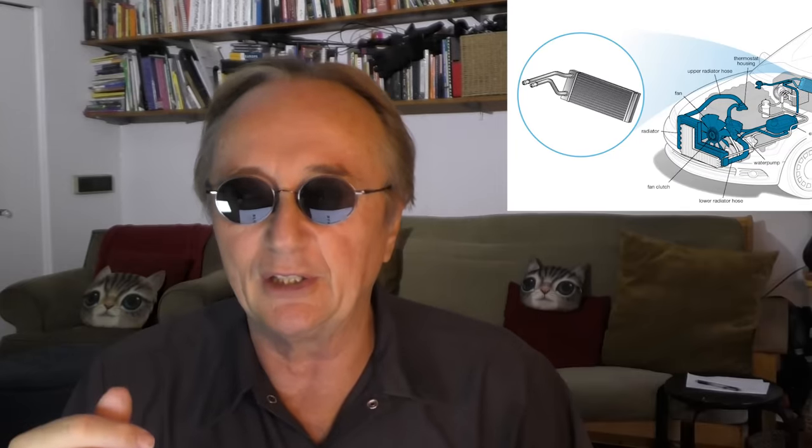Journey 19 says, Scotty, I got a 2000 Chrysler 2.4, 120,000 miles. Runs great, but my heat is only lukewarm. I've changed the fluids. I had a guy flush out the heater core, but it's still lukewarm. Hell, I work on enough of those things to tell you 99.999% of the time that means you need a new heater core.